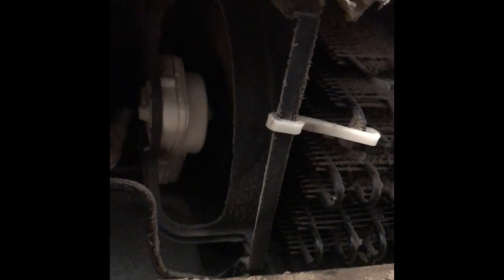The condenser fan is running, so that may not be the problem. Let me get a little light in there - so there is the condenser, and then you have this cooling fan that blows all over these coils. The coils are pretty dusty. So obviously it's not the fan because the fan is working. What I'm gonna do is vacuum out this whole area and try to clean off those coils and see if that makes any difference.